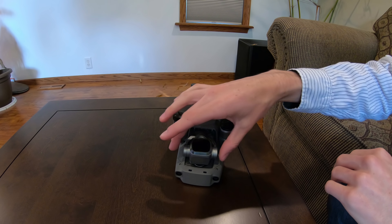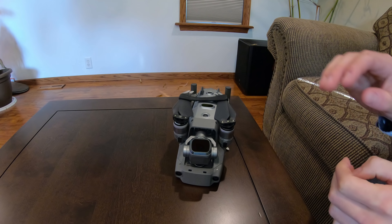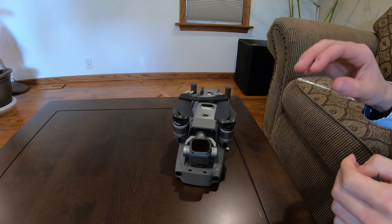These gimbals are a little bit more sturdy than the original DJI Mavic Pro, so I don't think you have to worry too much about really shoving on this. This thing fell from 20 feet high and there's completely nothing wrong with the gimbal, so it's fine to hold on to it with a little bit of force and shove down slightly while twisting. And there you go — you've got your ND4 lens on there.